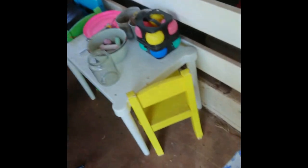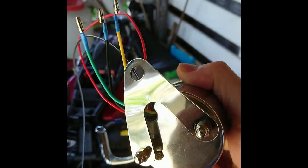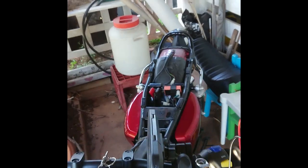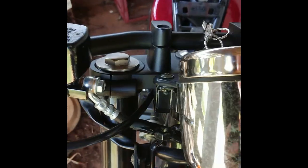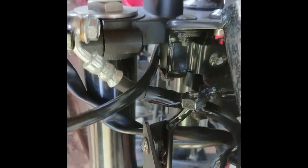Anyway, having said that, mounting the TACO is going to be up to you. You're going to have to try and figure out exactly how and where you want this thing to go. You'll notice it's got that bracket there — it's got a bit of a bend in it. The way I decided to put it on my bike is to weld a nut right there, and that'll have a rubber grommet on top of it and the TACO will mount on top of that. You could also use those two nuts there, here and here, and make a right angle bracket, which would fit it as well. Really, it's up to your own imagination as to how you want to put it on. I had a welder and I'm capable of doing rough but solid welds, so that's what I decided to use.